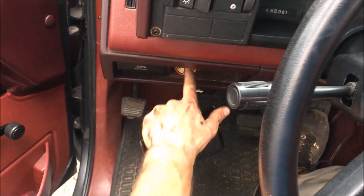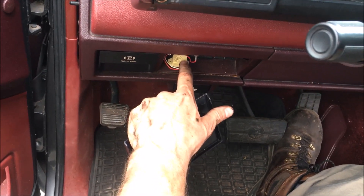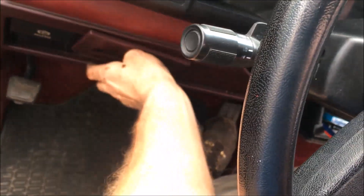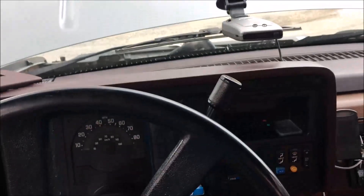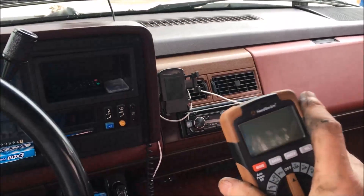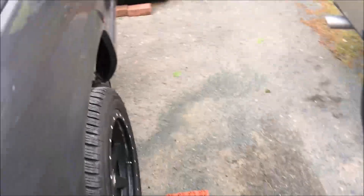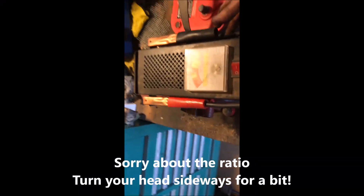When I came back, I had the battery hooked up and noticed that when I turned my headlights on, my little buzzer down here that reminds me the headlights are on was making a weird noise. I flicked it, thumped it, and finally got it to come on. The voltage is low — that's the only explanation. The radio was making weird noises, and the fans were barely moving. There was a voltage issue, even though I had good voltage — well over 12 volts — and the smart charger told me the battery was 100% fully charged, still showing 12.4 volts.